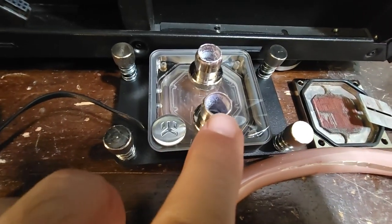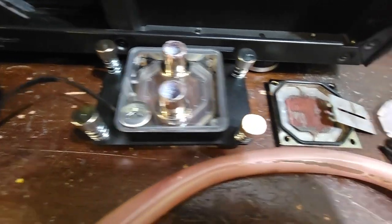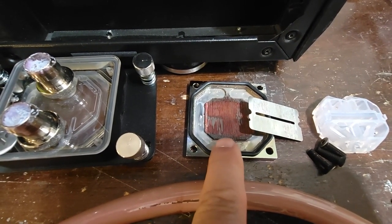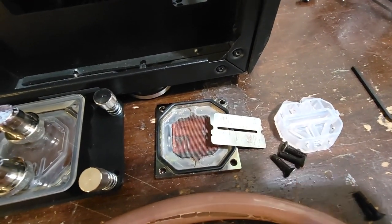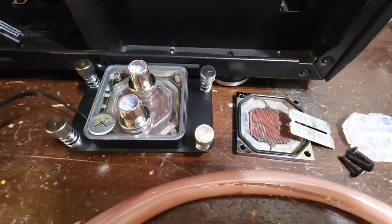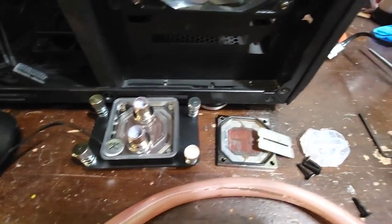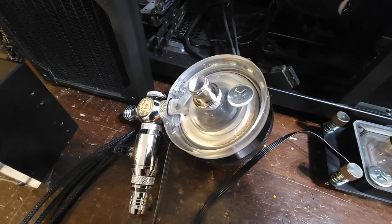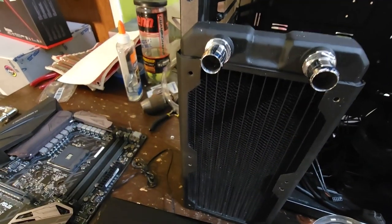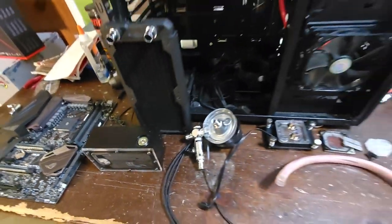As you can see, there's all this white flaky stuff and sediment on the inside of the water block. It's an EK water block with RGB lighting on the inside, but it's not a copper water block — it's an aluminum water block, and it rusted. There's a metal plate inside, a flow restrictor, and little plastic pieces. I had red dye that had caked up and was sticking out everywhere. It was all over the inside, restricting the flow. Basically it got contaminated and rusted — it's now a paperweight. The pump is still working, and the 240mm radiator is probably still okay, but I wouldn't use it because it got sediment in there as well. The reservoir is probably usable, but I wouldn't use it now either.